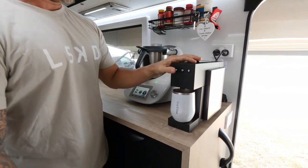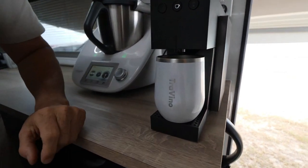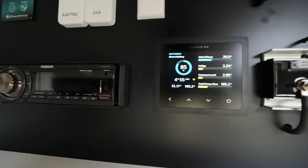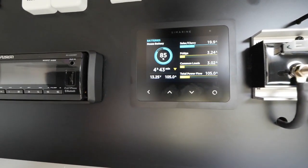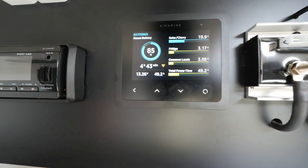A lot of people will agree with me that the coffee machine is the number one appliance in the caravan. So we've switched the inverter on — we'll just press the button and we will get some gorgeous coffee coming out of the machine. You can see the bottom reading is your total power, so it's fluctuating between about 10 and about 100 amps. Bear in mind we're putting in 20 amps of solar — so very efficient for about a 30 second coffee machine run.